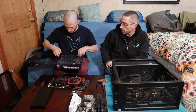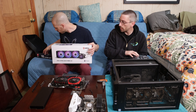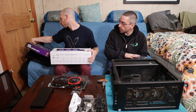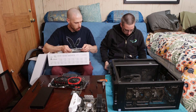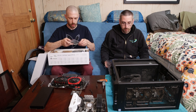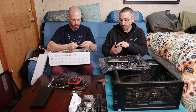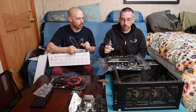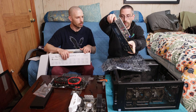I am excited about this motherboard. We went with the MSI Z690 Edge Wi-Fi — MPG. LGA 1700. That thing is sweet. I like the dragon. So here's the bracket — this goes on the backside. One thing I mentioned before was that it needed stickies, and now there's stickies. Somebody was listening. This will line up with the holes in the motherboard and stick on the back so that all the hardware can mount to the top. Just pull the stickers off and stamp it on the backside of the MOBO. So we've got the bracket for the correct socket on the back of the motherboard.